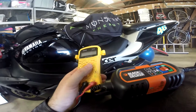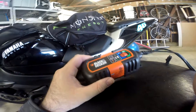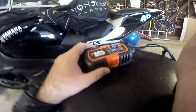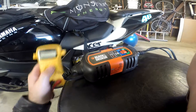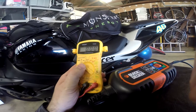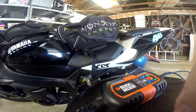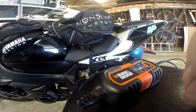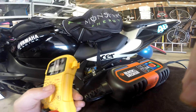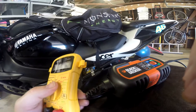How do you know if it's the battery or the stator or the rectifier? One way: charge your battery up overnight on a battery tender. Then go to your multimeter, put it on 20, and look at the reading. If your battery is reading 13 or higher, you've got a good battery and it's most likely something else. But if your battery is not holding a charge and it's below 13 — maybe 12.90 or 12.80 — then it may be your battery.